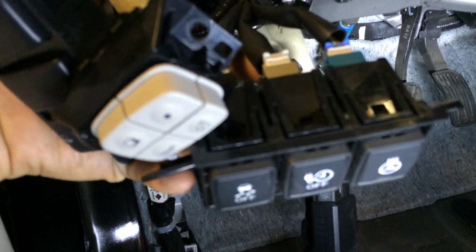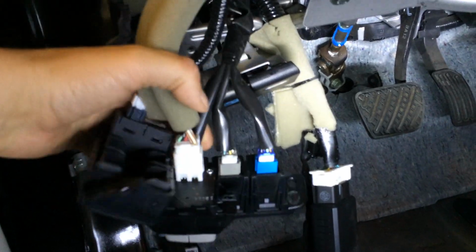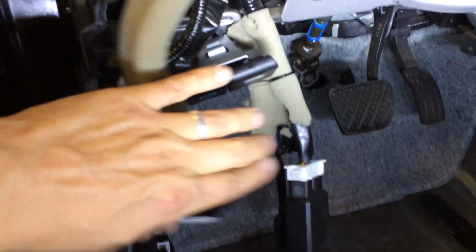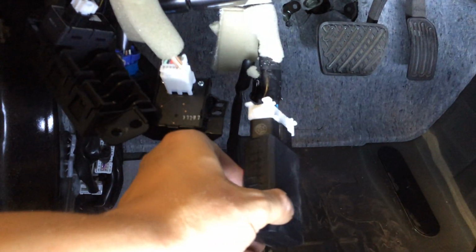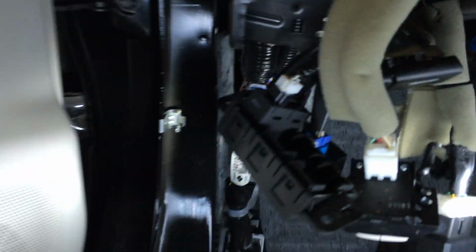So down in under the driver's side here, you can see all the various switches that had been in the dash panels. So those are generally all still hooked up. There's another fuse box up here, and then the diagnostic port, which I've got a Wi-Fi scanner on so I can use Leaf Spy. It's been really helpful for resetting DTCs and the like.